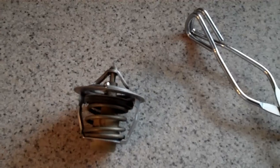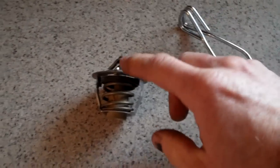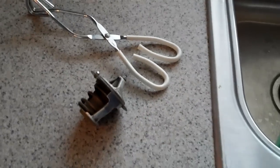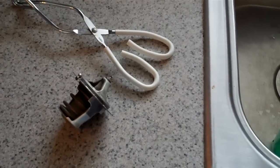Most people are cooking a turkey on Thanksgiving; I'm making a video on boiling thermostats. I've done a lot of these tests. This is the best way because you can buy a brand new thermostat and it can still be bad. You don't want to invest a ton of work putting in a new head gasket only to find out you installed a defective thermostat from the factory.